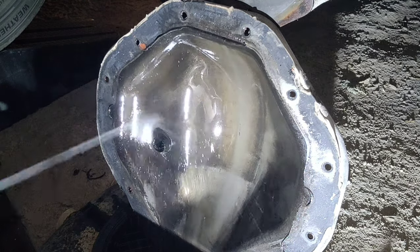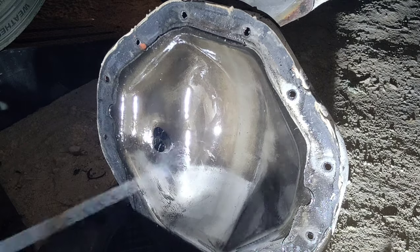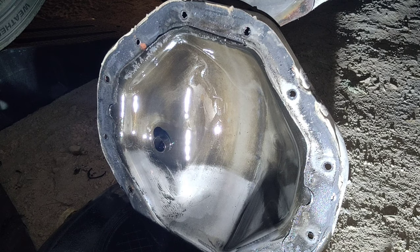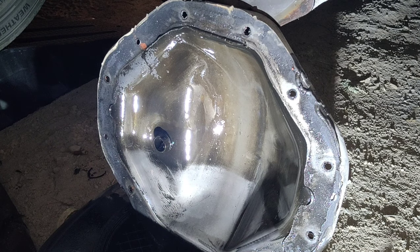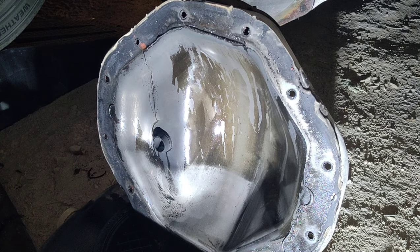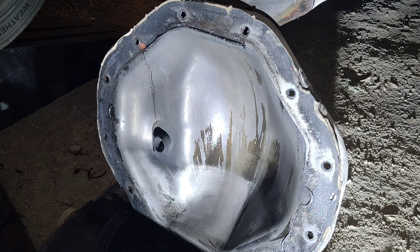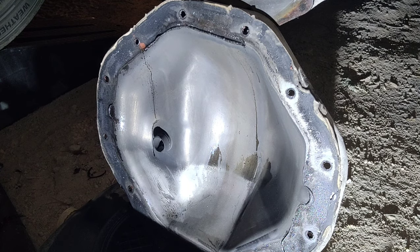Let's give it a little spray of brake cleaner so you can see where the natural level of the differential is. That burns in the eyes - safety third. Make sure it's all out and dry before you stick that back on and put your diff fluid in - you don't want brake cleaner in there modifying and breaking down the fluid.